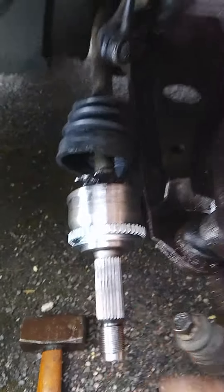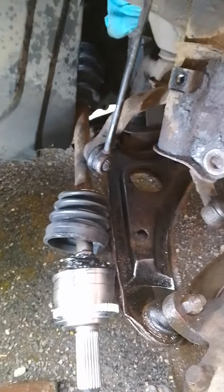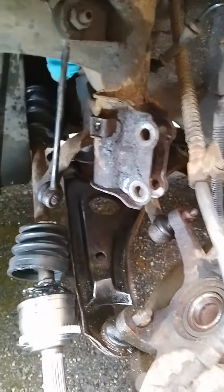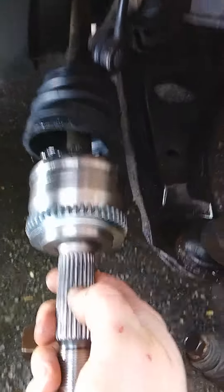Once you've knocked it back in place, these are loose and 17mm. These can both come out then. Take the 10mm off there, put the steering on full lock left because this is the passenger side on a British car. Then drop this hose underneath and back up again. That gives you enough clearance to get a nice straight clear run on that.